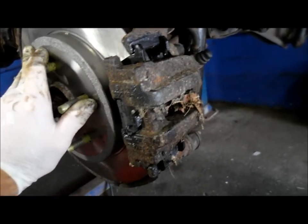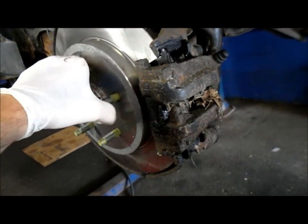Let me recap exactly what we did: we unbolted the caliper here and here, took it off and swung it out of the way. Lubricated everywhere that the brake pad is going to go. Made sure the surface was clean where the rotor was being mounted back onto. Lubricated the brake pads when they slid into the caliper, and tightened up this bolt on top and this bolt on the bottom. We're all set here — I did the other side earlier, and now we're going to go up to the front.